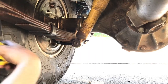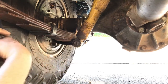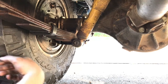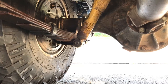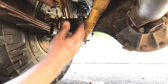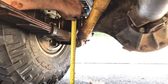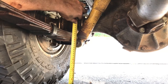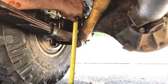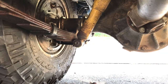Okay, it's all in. I just ground the bolt that holds the spring pack together - that was sticking out a little bit so I've ground that flat. As you can see it's a nice smooth surface now, so you're going to slide over rocks and whatnot and won't get hung up as easy. That's 26 centimeters - I was at 24 before we started, so just over 26. That's very close to an inch of clearance, and all we've done is replace those spring plates.